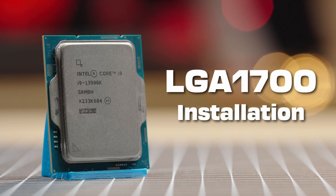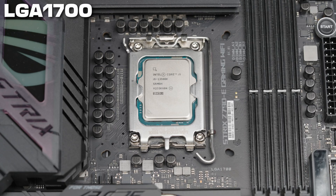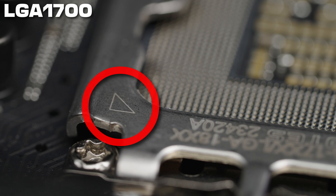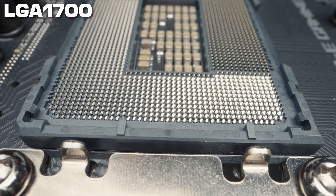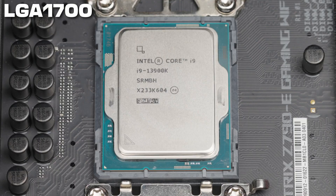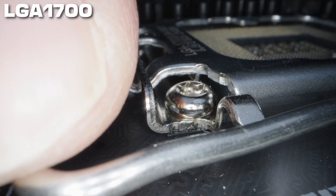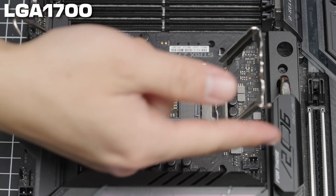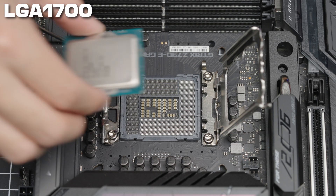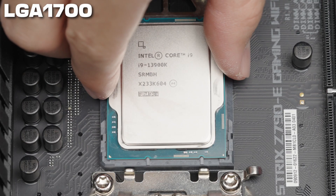Installation of an LGA1700 CPU is very simple and similar to the AM5 installation. The socket pins are surrounded by a retention bracket to hold down the CPU, held in place with a lever along the side. There's a small triangle on the retention bracket indicating the orientation of the CPU, and a corresponding triangle on the LGA1700 CPU. There are four total notches on the socket — two on the top and two on the bottom — which are off-center and asymmetrical, so there's only one way for the CPU to insert into the socket. To install, press down on the small lever next to the retention bracket, releasing it from the holding hook. Raise the lever to relieve tension on the retention bracket, then raise the retention bracket to expose the socket and pins. Firmly hold the CPU on the sides, gently place it into the socket making sure the triangles and notches are oriented correctly. Press the CPU against the bottom of the socket and feel the notches align.